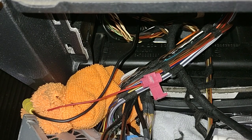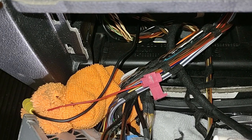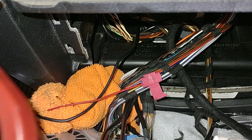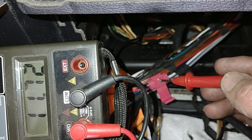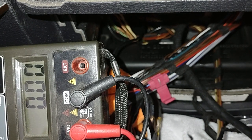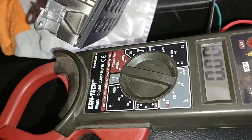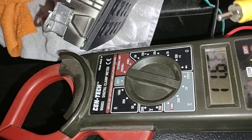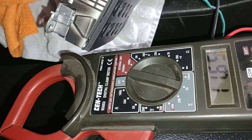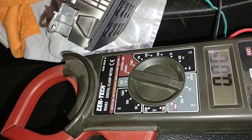Now let's make really sure we got that. I'm going to use my voltmeter — connect it to a ground, turn on the DC 20-volt scale. To test it, I can just touch the metal piece and verify: yes, I do have 12 volts there. To be doubly certain, I'm also going to check that I have 12 volts at the other end of the cable. I'm down to 11.66 volts by virtue of having the key on and the car not running, even with the battery charger — so keep in mind you'll probably need one to do this job.